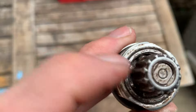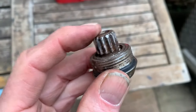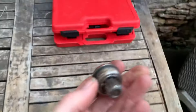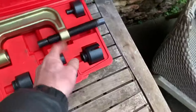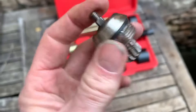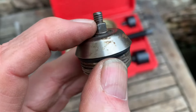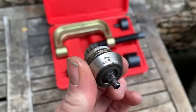That bearing is no longer sealed — the top seal has disintegrated, which is why dirt and grime has got inside, which is why it no longer works. I'm going to use a ball joint press because I work on cars and happen to have one, but you'll probably find other means of getting this out, not least simply whacking it with a hammer. Make sure if you do whack the top with a hammer, you put the nut on first so you don't damage the threads.